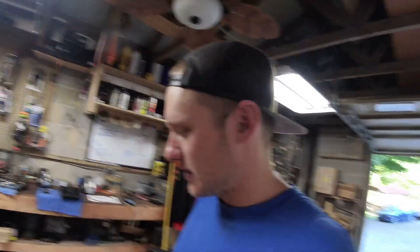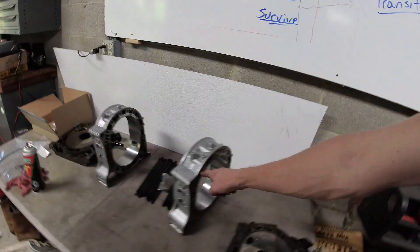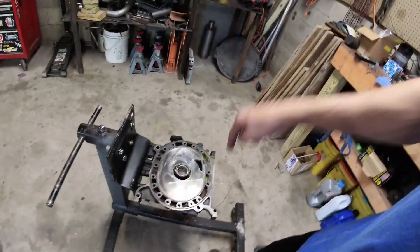Welcome to today's video — we are stacking yet another REW on the channel, but doing it a little differently. I've got irons, baby half bridge port, everything is ready to go, clean, with front and rear marked. Exhaust ports are done, rear iron's done, stud kit is chilling ready to be installed. One thing with the stud kit I like to do is run the stud into every hole on the front iron so there are no surprises — every single stud goes all the way in.